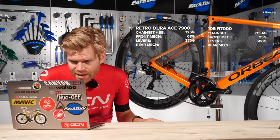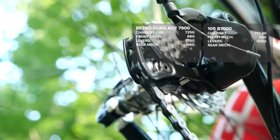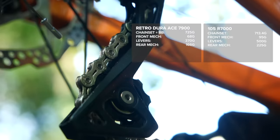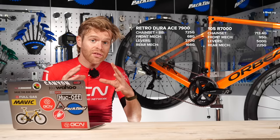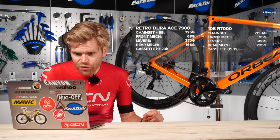The rear mech is 166 grams on the Shimano Dura-Ace, 225 grams for this one. But again, it's a bit of a bigger rear mech. We've got a longer cage on there. So it's not all down to just the fact that it's 105. The cassette, well, that is quite a big difference.